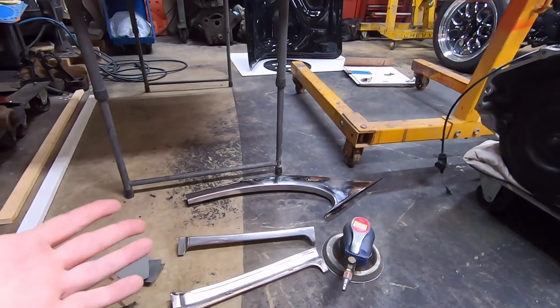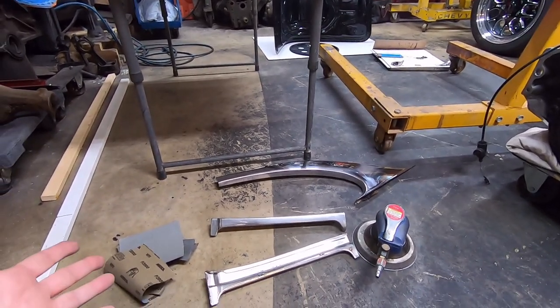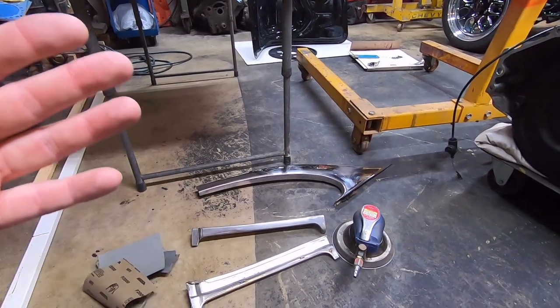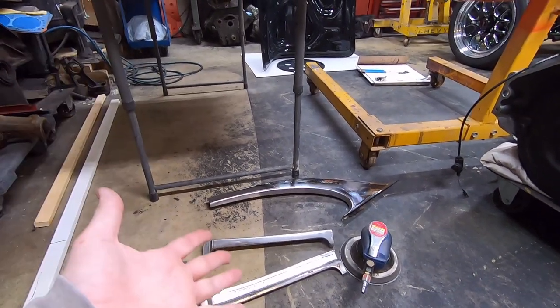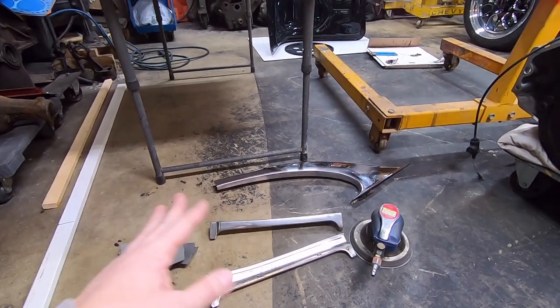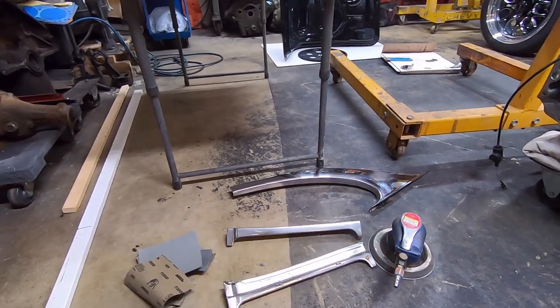I would use steel because you're going to sand and polish it anyway. Now you don't ever have to hammer the crap out of this stuff. You can sit there and work it a little bit, but I will use a really fine file. You can get a set of files for jewelry, those little bitty fine files, and you can really go in there and fine tune that dent back down level that way,